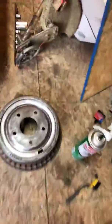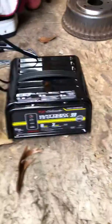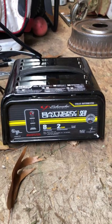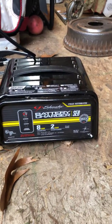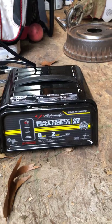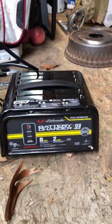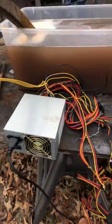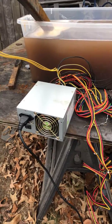I am going to high heat paint or prime and paint these. Most electrolysis videos you see on YouTube show using a battery charger. Well, I went and got one from Lowe's, but the problem is it's an automatic charger, as most of the newer ones are. If you have an old battery charger, you're golden because it will turn on and go to a constant 6 or 12 volts. The new ones will not do that. So that was why I came up with the power supply solution — I did a little more searching on YouTube and this is what I came across.